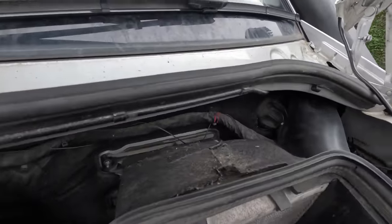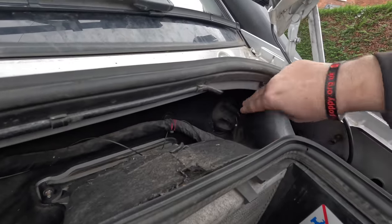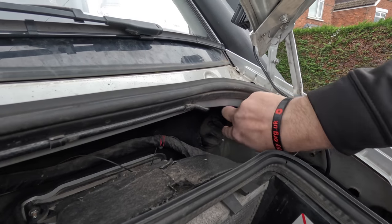So what we need to do is, this is the grommet, I don't know if you can see, just here on the Sprinter. We're going to get the cables for all four of these lights through this grommet. Unfortunately, this means removing the glove box to get up to where the grommet is. Then we're going to put both the relays in where the battery is, which gives them the power. We're then going to put all four cables that come with the pre-done plugs to the spots, so that's them wired, and then all we need to do is the switch cable.